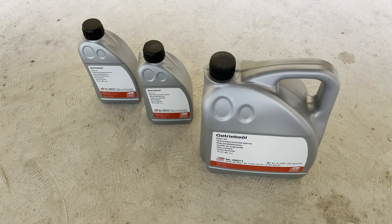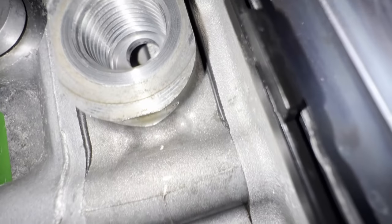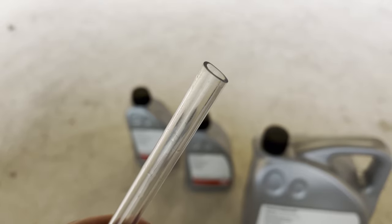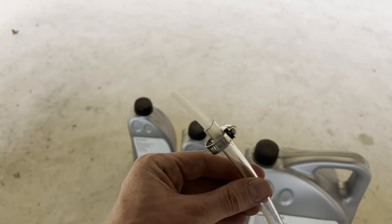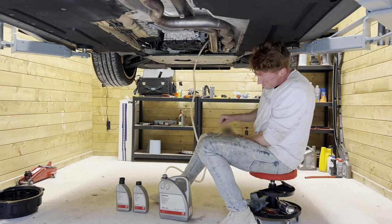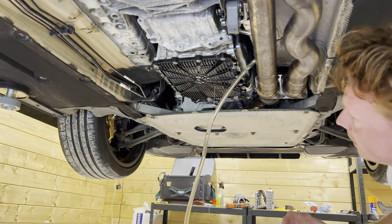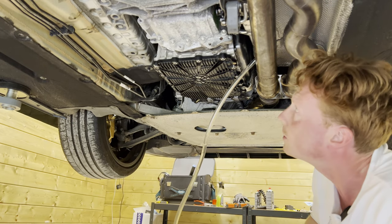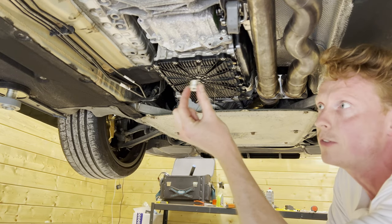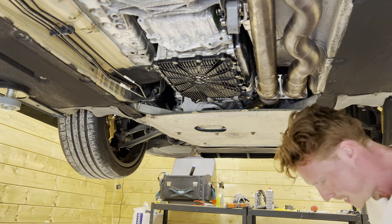And that's all of them. The next step is to get the gear oil into the gearbox. As you can see, the hole in which the oil enters is very narrow — this end of the fluid transfer pump is too large to fit in, so I made a custom adapter. It's a bit ghetto but this is how I'm able to get the oil into the gearbox. Now we can see it overflowing, so it's pretty much full — we've inserted almost five liters. We're going to take the pump out and close the hole with the fill plug, snugging it up for now.